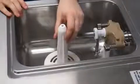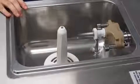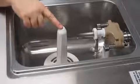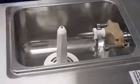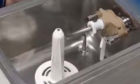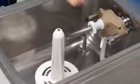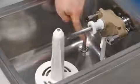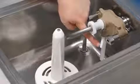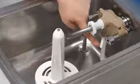And the mix agitator slides back over its agitation shaft until the metal can be seen clearly through the top. When sanitizing the machine, sanitizer should be pushed over every surface in the unit. But when filling with mix, it should never be filled above the line of the selector handle on the bottom of your white plastic pickup tube.